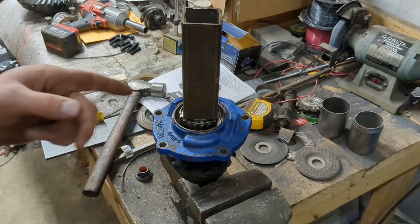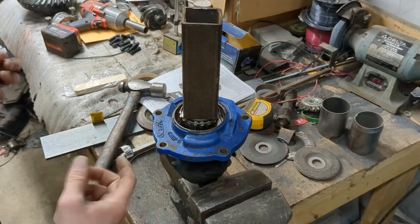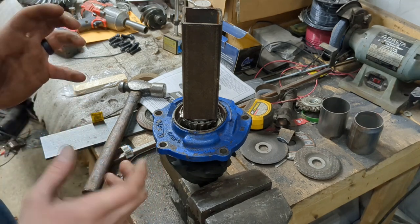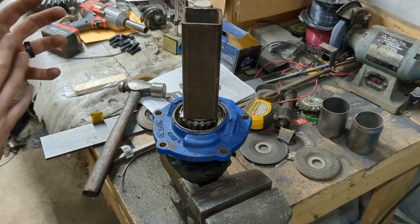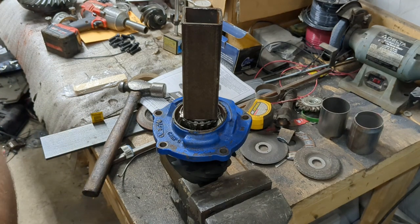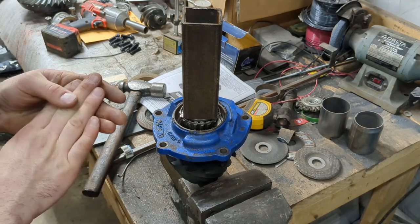What we don't want to do is tighten it so much that we start to crush our crushed sleeve. I'm going to need a quarter-inch beam-type torque wrench to measure our pinion preload as we're spinning around, and that'll be here tomorrow. So for the time being, I'm going to just snug this together, run the pinion yoke on with the impact, start to crush the sleeve a little bit, get just a touch of drag on the bearings, and then leave it until I get my torque wrench. Then we'll continue working on the carrier housing.